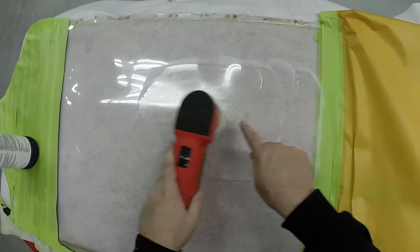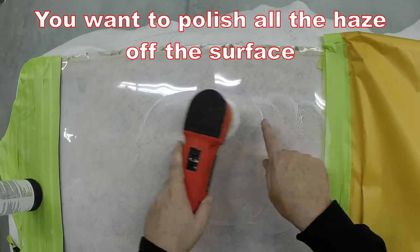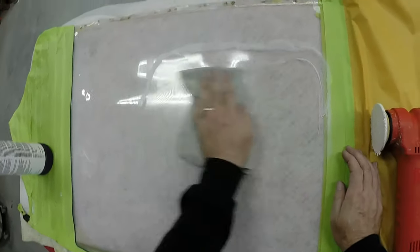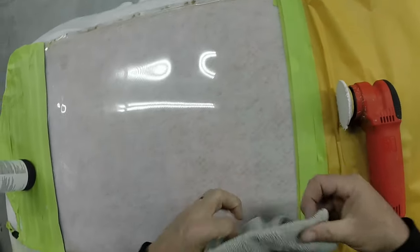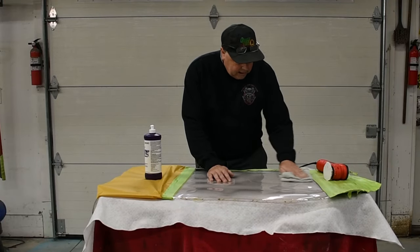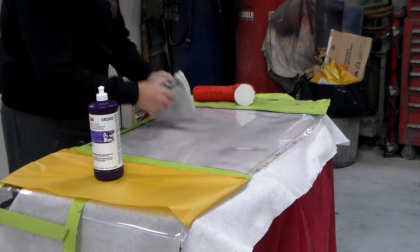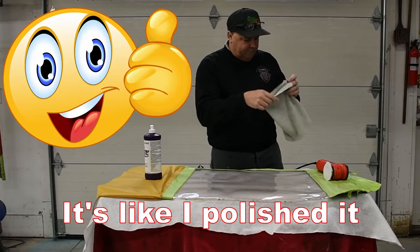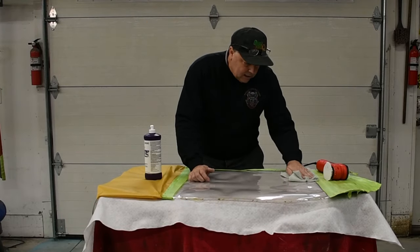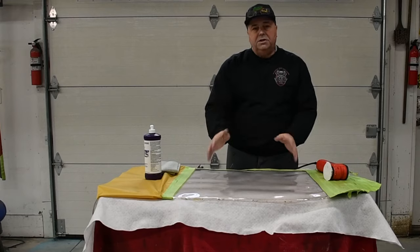You can see how back here the haze is gone, but as I chase it down the window I can see I'm chasing that haze. I'll wipe this down. One thing I notice is my gloss is coming up, but my plastic gets very slick — almost like I've polished it, which I have. There's no debris left on there; it's polished it off. So I'm going to continue to work this area and do this entire inside of the window with the microfiber and step one.